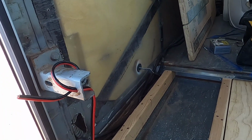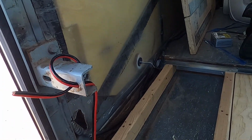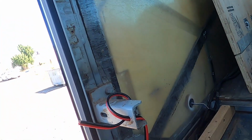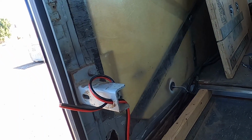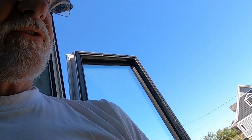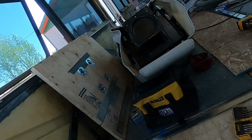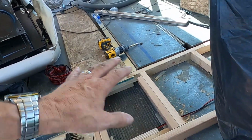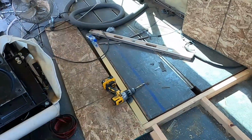Those could be probably smaller fuses for that. And so the fuse over there will protect the main wire coming across, and then the fuses here will protect the individual smaller wires that'll go into the various accessories. So with running this wire underneath, it's going to be somewhat permanent because I'll be fastening this floor down, fastening all this floor down, putting more flooring in.